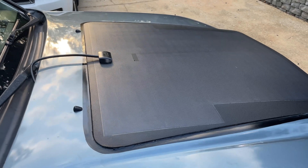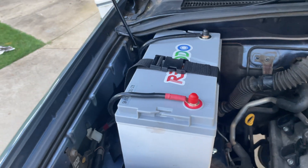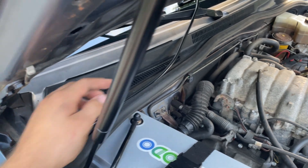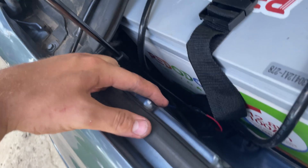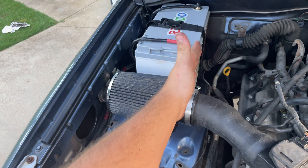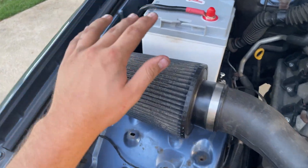On the hood is a 100W panel from Linsun Solar. Here's the 12V 100Ah battery from Redodo. It's strapped down to a battery tray that's bolted to the body. The solar panel cable runs down here and right between the weather stripping that seals the hood to prevent water from getting in. It then connects to two more cables that run through the firewall and to the solar charge controller. Soon I'll be making a custom heat shield that will go along the battery, have a hole for the intake, and cut off right here to keep it a bit cooler so the battery performs better.